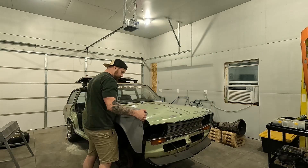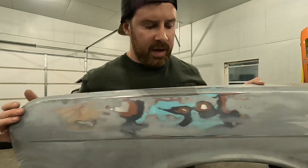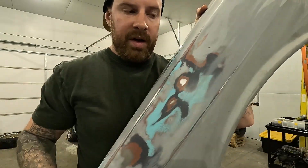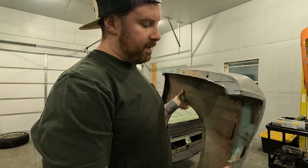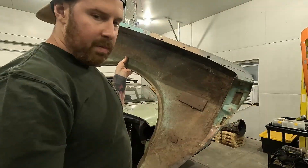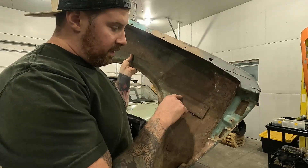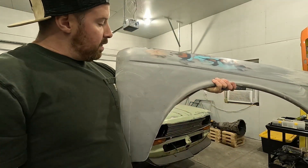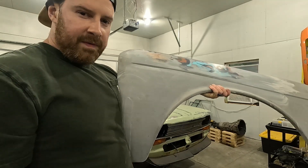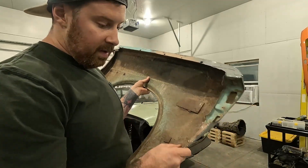I'm going to start with the fenders because they're quick release. This is the driver side fender. I've already done a little wet sanding and found some cool paint underneath. Ryan Hicks in Ohio told me about this — these fenders have had the marker lights deleted in a not-great way; someone tack welded in a piece of steel and then likely bondoed it smooth.